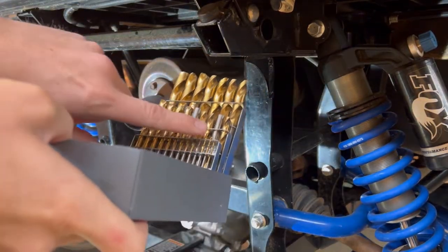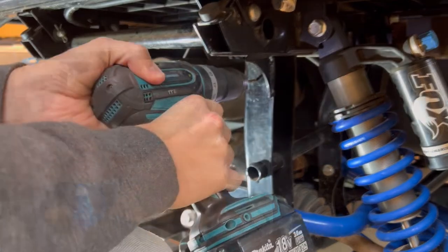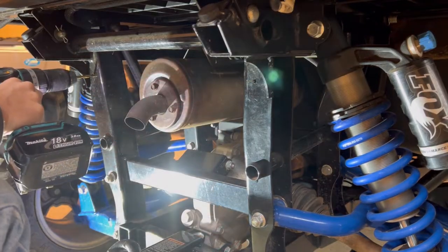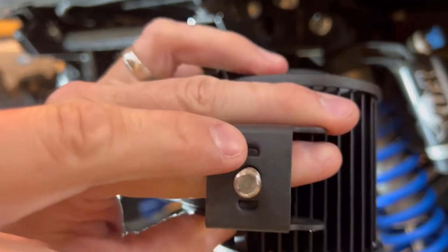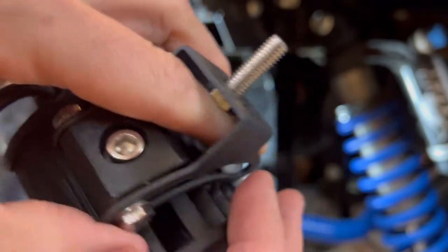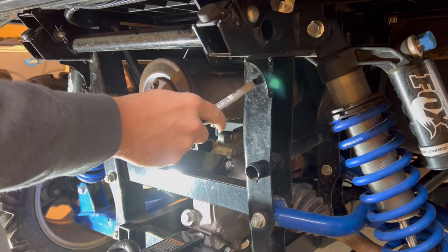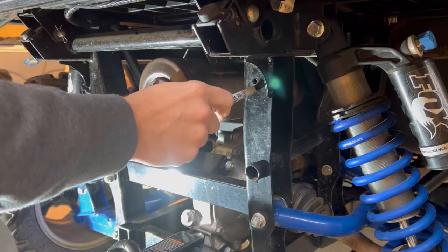I have my drill bit set and I'm going to walk my way up — probably three or four drill sizes — up to the size I need, just confirming there's nothing on the back side. It fits perfectly. This design is pretty convenient; they have these little notches here which stand proud on the other side and capture it so you don't need a wrench in there — you can just put it in and tighten from one side. Since this is fresh-cut metal on powder coat, I'm going to put a little paint in here and let it dry while I go back and start doing the wiring so it won't start rusting.